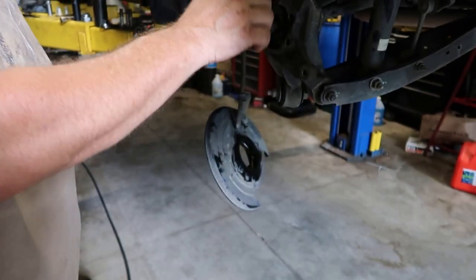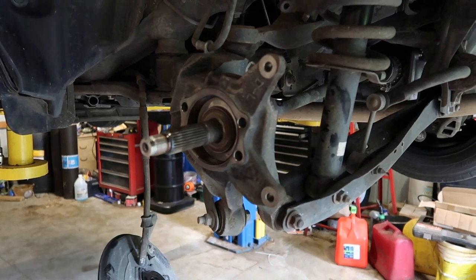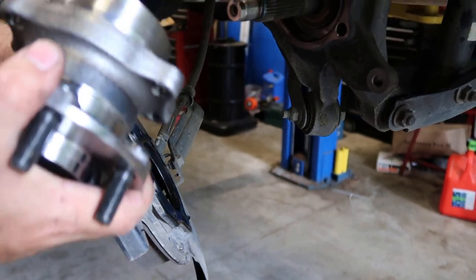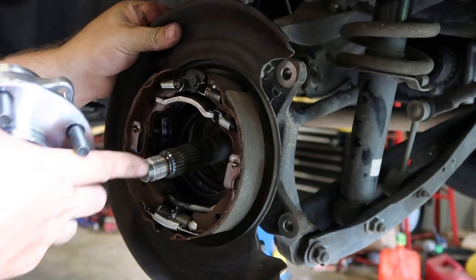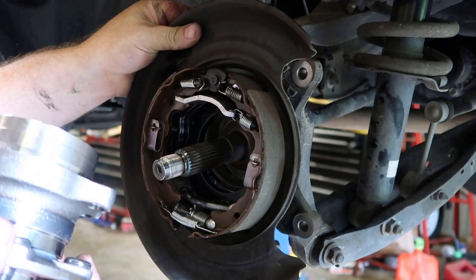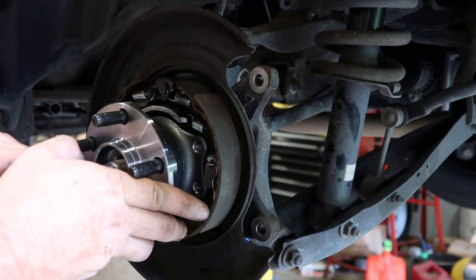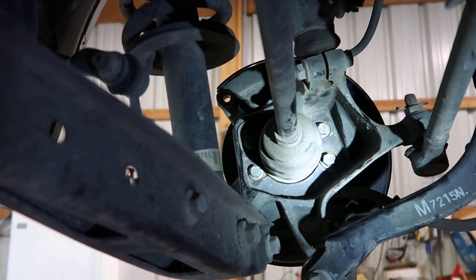I cleaned this up real good. Now if you got a lot of rust, I did put just a little bit of oil there and rubbed it in — mine wasn't really rusty but I went ahead and did it anyway. You could probably use anti-seize or something like that. I also went ahead and cleaned the back of my backing plate real good. Now we're gonna be ready to install this bearing. All you do is go ahead and put your backing plate up. You can put some grease or anti-seize on your splines of your CV axle, but mine wasn't stuck and we don't have much of a rust issue down here in the south. So we're just going to go ahead and install this bearing without putting anything on the axle — just grab it and push that axle from the back back through here, and then we're ready to install. All these bolts are going to be torqued down to 48 foot pounds of torque.